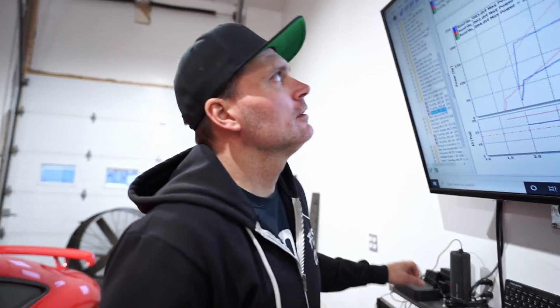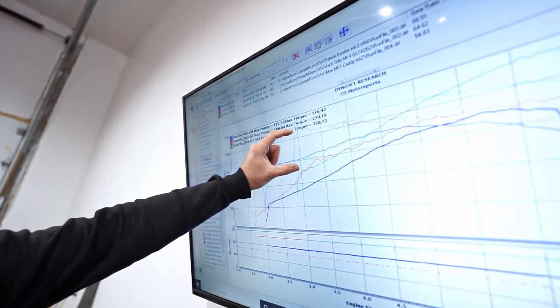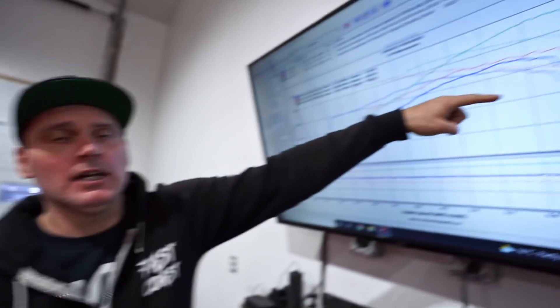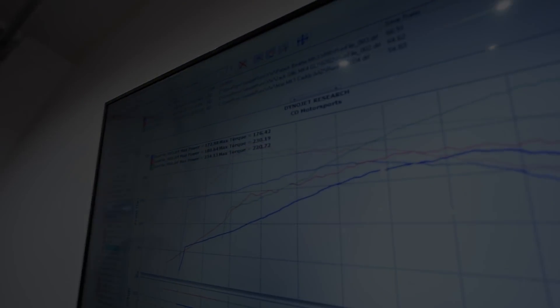Afterthought: 180, VR, or 2.5? I would 1000% take the 2.5 every single time in a front wheel drive car. One thing we kind of forgot — we did have a 24 valve 3.2 on the dyno as well. That changes the game quite a bit. The torque is very similar down low to the 180, and it makes substantially more power up around 6000 RPM. Peak torque the 180 still made a little more, but it wasn't far off and in that case the VR did carry the torque further. That's a different animal from the 12 valve.